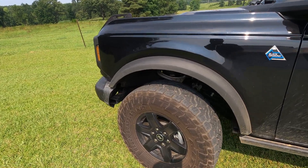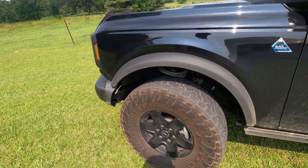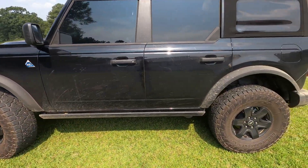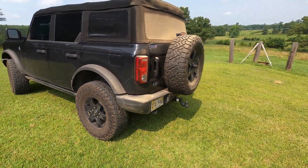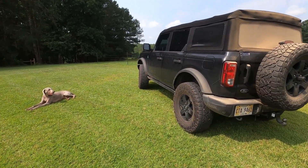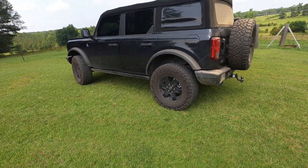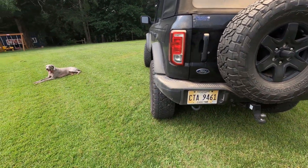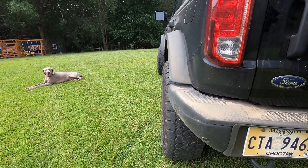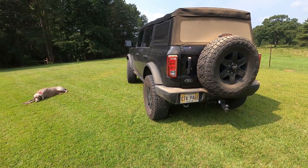You can see I do still have my crash bars front and rear. There is very minimal scrubbing if you're doing some off-camber turning at full lock, but it's very minimal and once you get used to where you can and cannot turn, you don't notice it anymore. I could take them off but they don't hinder me on a daily driving application. As far as the outside — the lift, the tires — there are no wheel spacers, that is the factory offset. Down the side they've got a little bit of poke, hanging out of the fender maybe a half inch, but I really like the way it looks.